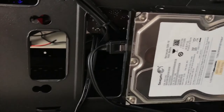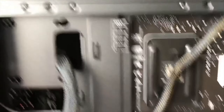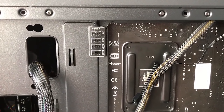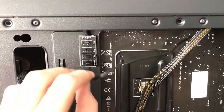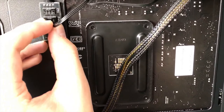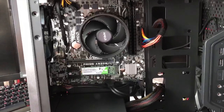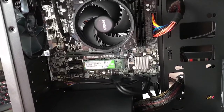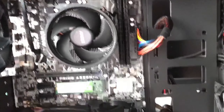I've tried to do some cable management, really utilizing the bottom tray to stash away most of the cables. I've also installed the fan header and the fan hub, which goes to the extra header on the motherboard so I can plug all the rear connectors in. There we go — that's fan one and that's fan two, and I did also install a spare fan. The cable management is pretty decent; you can't really see most of the cables from the front side, though there is a small gap visible at the bottom.